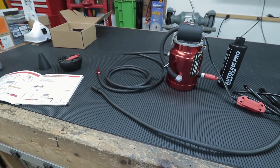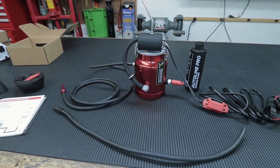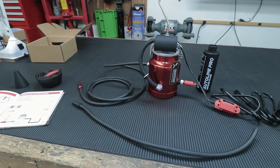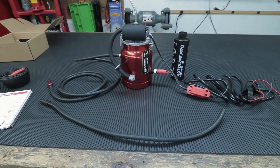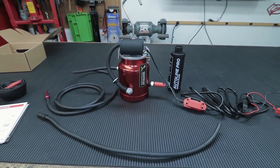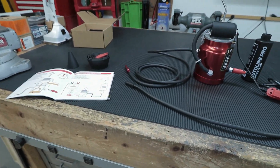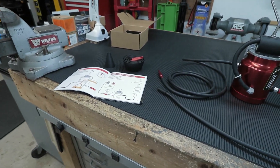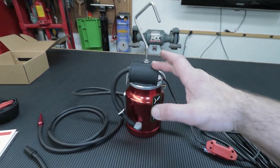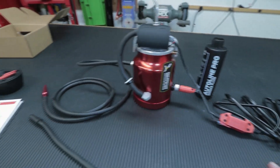To make it easy for myself, I went ahead and got something like this — this is an AutoLine Pro smoke machine. It's going to inject smoke into the system and it's going to basically billow out where it's leaking. This is the easiest way to figure out an evap leak if it's not the common issues like a gas cap or the purge solenoid. This is the version that has the built-in motor, and it's a very simple system.